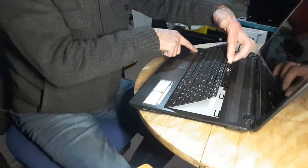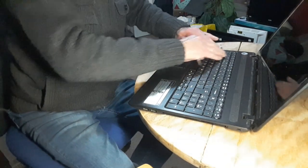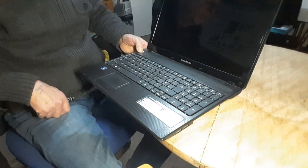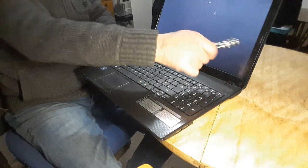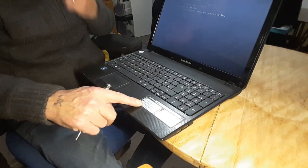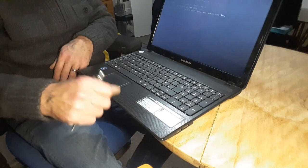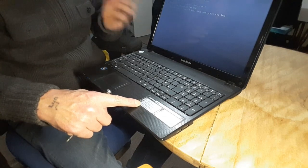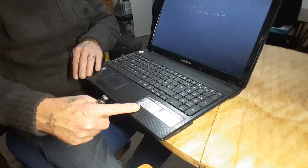Put all the little lugs into the relevant slots, line it up, and clip it back into place. And then we have a repaired and upgraded laptop. It comes up branded Acer — on the label it says E-Machines, but it's technically a rebadged Acer. This machine has now got a Core i5 brain in it, as opposed to the original single-core processor. It only had two gigabytes of memory — it's now got eight. Once we put the drive in and get Windows on — we'll put Windows 10 and 11 on here — we'll show you a little trick in the next video on how we do that.